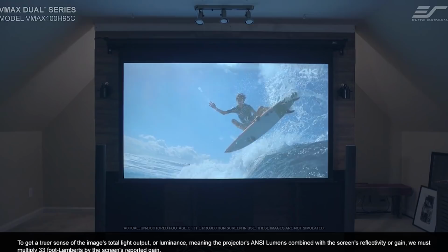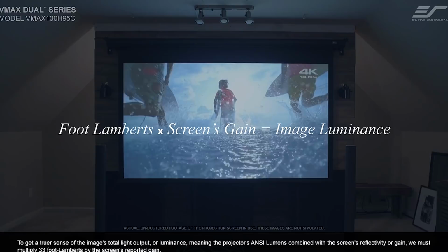All right, so we talked about projector screen types and size, but what about the different types of screen material? Well, this is where things get more complicated. So there's a bunch of different types of material and finishes, but the main things to consider are gain, color, and texture. All right, so first let's start with gain. So gain refers to the amount of light that is reflected off the screen and back to the viewer. So the higher the gain, the brighter the image.